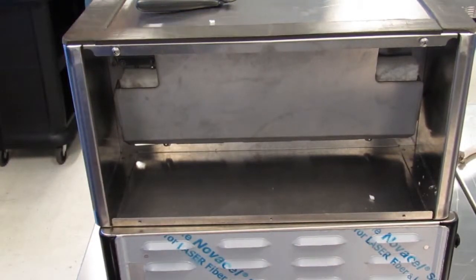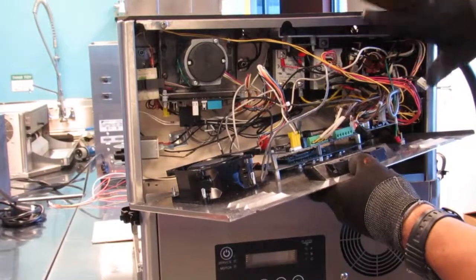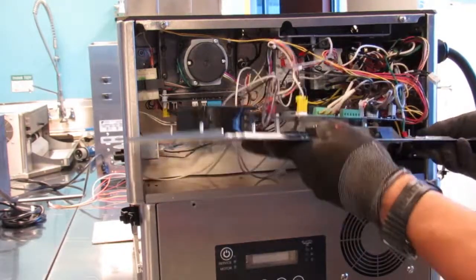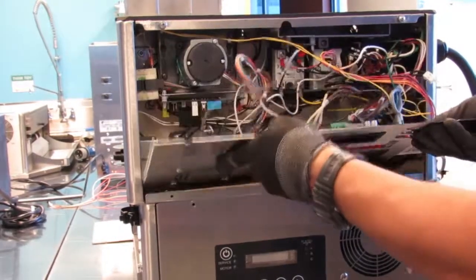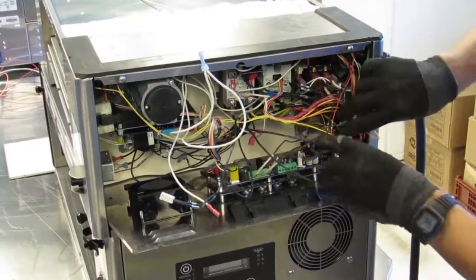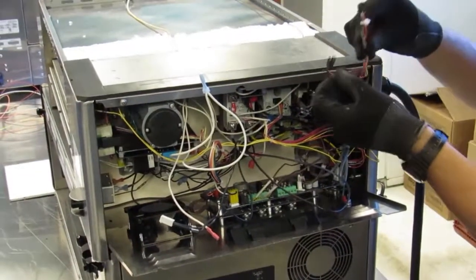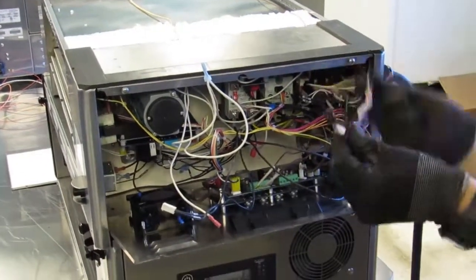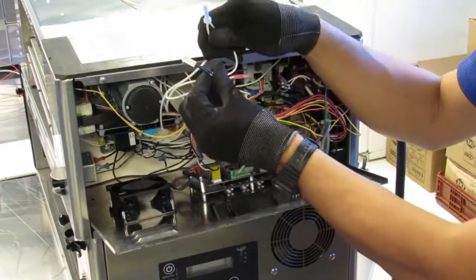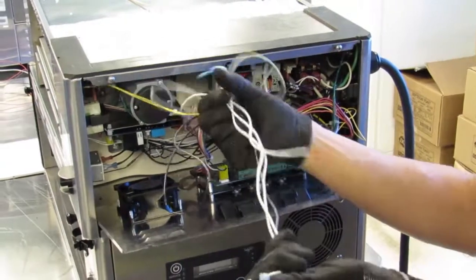On the opposite end, open the display side panel. With the display side panel open, position it so we do not over stress any of the wiring harnesses. Locate the low voltage wire harnesses — the six wire and two wire — and completely extract from toaster. Next, locate the black and white high voltage wires and completely extract from the toaster.